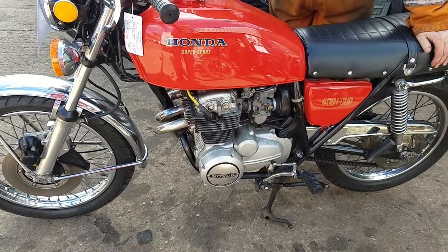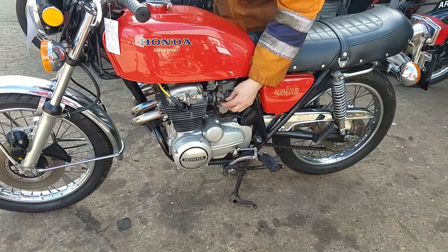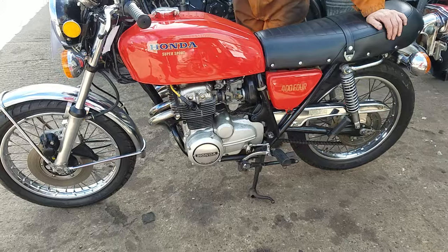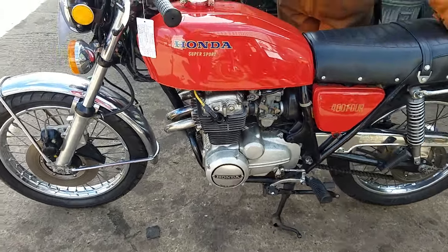There's a little fluffy spell between 3,000 and 4,000 revs, and I think it's a little bit lean. You pull the choke on a little bit and that clears. But this is a cold day — on a warm day it might be fine. It might be something to do with the four-into-one, I don't know.